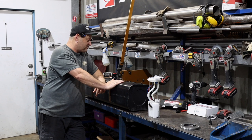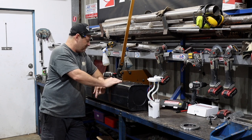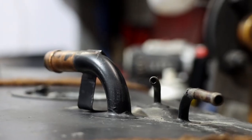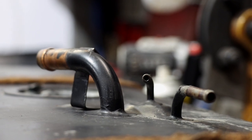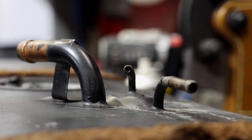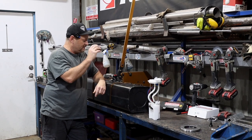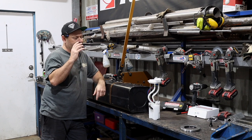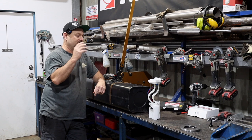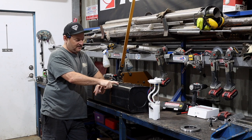So obviously, a carbureted car has no provision for fuel pumps or anything like that. Basically it just has a float inside there for fuel level and a 6mm and 4mm fuel line for feed and return. They're just suction pipes that go to the front. There was an old electric fuel pump in the front there that was servicing the engine. None of that's any good to us. The lines aren't big enough for a start, but also obviously we need high pressure stuff. So we're going to fit a fuel pump assembly inside the tank.